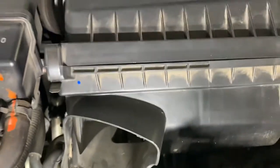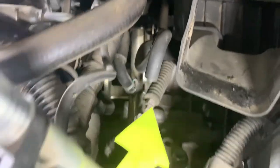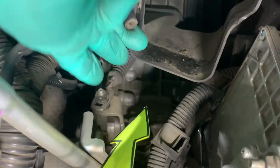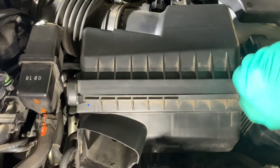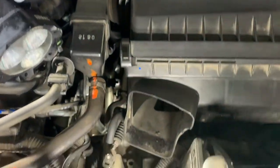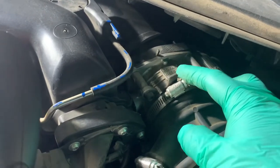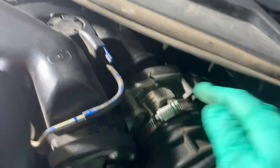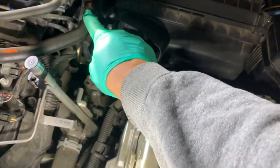Okay, so there's the air box, and that's the tube that's not connected to anything and doesn't look like it needs to be, so maybe that's the natural aspiration part of it. It's not even plugged up, it's just a hose that's not connected to anything. So my next move is to undo the air box here, probably take out the filter, and clean inside there a little bit. Also I'll take out this one right here, probably with my 5/32, 9/32, and leave this connected and pull this over. That way I don't have to disconnect here.